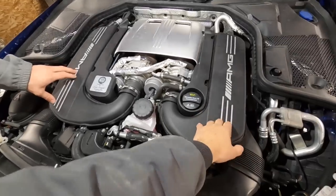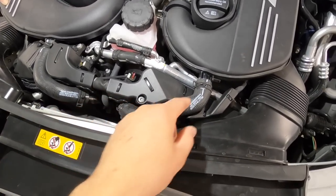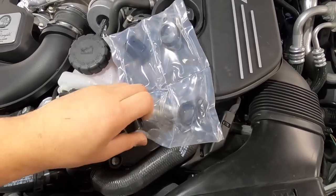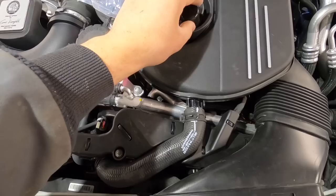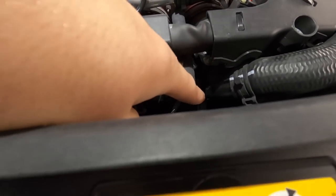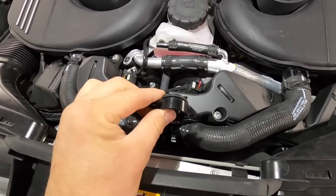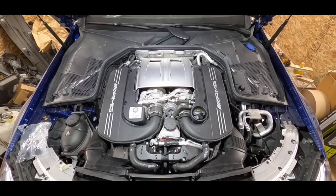Yeah. Under these panels. And then the VTAs are very simple. Basically you unplug this over here, and then here, you just put a little cap on. See this cap right here? You just plug this up, boom, and then this hose, you delete completely. And then on the other side of the hose, you can see in here, there's two little screws. It's very straightforward. We're gonna get it off, and all you do is install this VTA adapter. It comes with the seal and everything, so it just plugs up over there, and then you delete this hose. That's it, pretty straightforward, let's get it.